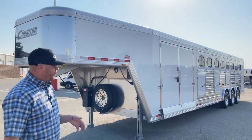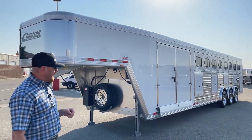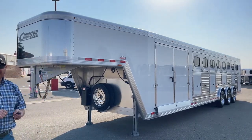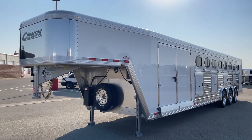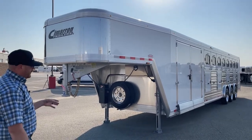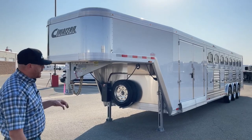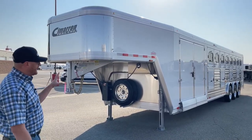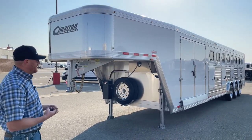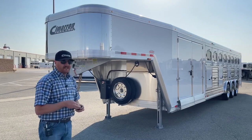There is definitely a lot of benefit to that — just making it a lot more user friendly getting in and out of tight situations. This trailer has a lot on it and is very well set up. I challenge somebody to find better running gear than what's underneath this trailer: three 8K axles, 18 ply tires, 19.5 inch wheels, and air ride suspension.